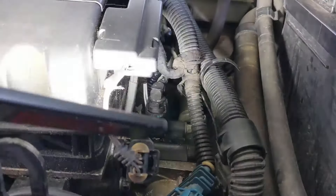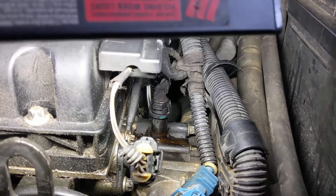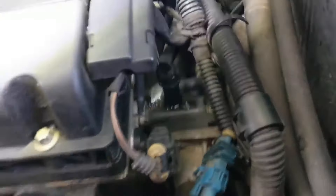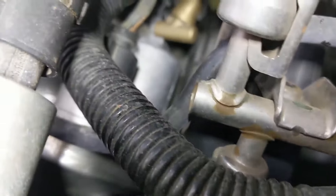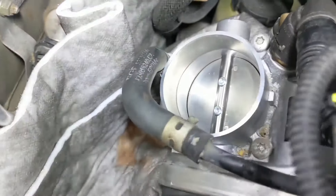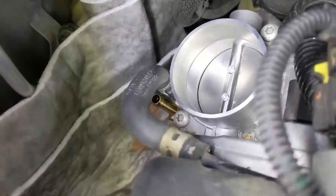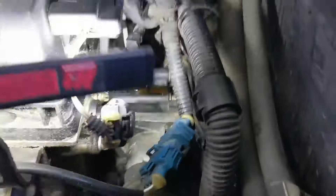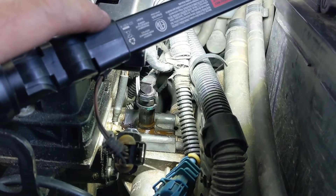I'm working on this little leak here. Out of the thermostat housing comes a little spout, and on top of that is the hose that goes around the back, under the engine computer, down and around to the throttle body. I've disconnected it here on this end - that's the throttle body inlet hose or heater pipe. What appears to be the case is that the little plastic piece that sticks down in there is cracked.